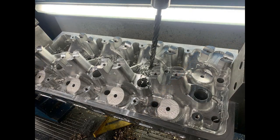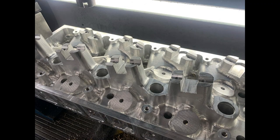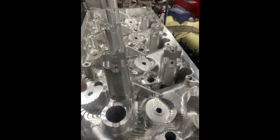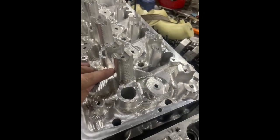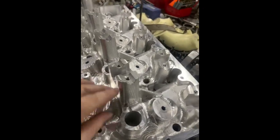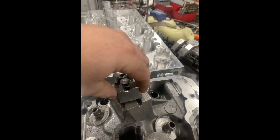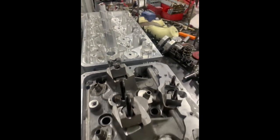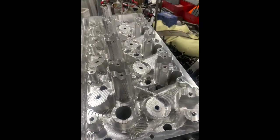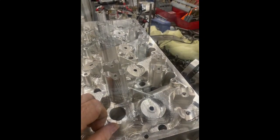This is just a preliminary video to introduce you to Design Performance — their billet heads and intakes. It's amazing to see behind the scenes of a father and son business. On their billet head they incorporated the rocker stand so it's all one piece. If you want a bolt-on rocker stand you can cut this off, drill and tap a hole. They did that because they had problems with rocker stands rocking back and forth and eventually pulling the threads out. They have fixed that problem with these, and it has seen extreme stress and done really well.